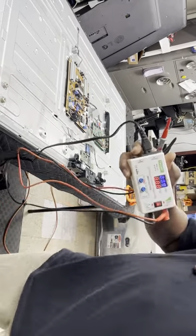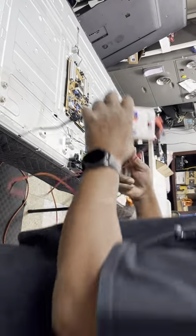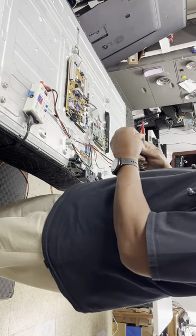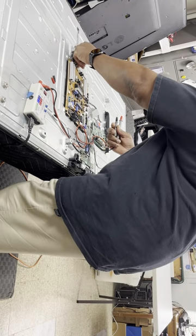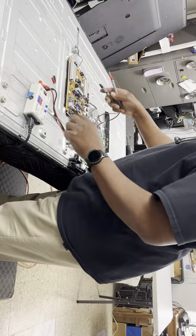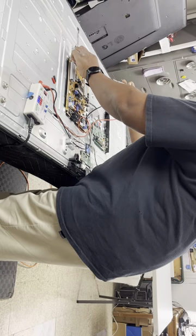That's what it looks like up close. If you haven't used one of these on your TV, you haven't proved that the LEDs are bad in the first place. It could be a bad power supply. This TV is known to have a power supply that can be flaky sometimes too. Sometimes you have to replace the LEDs and the power supply.